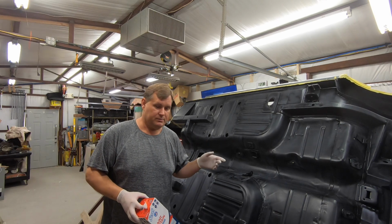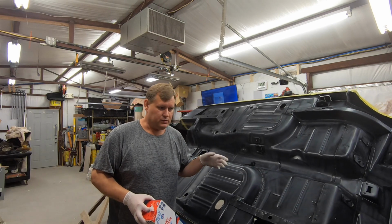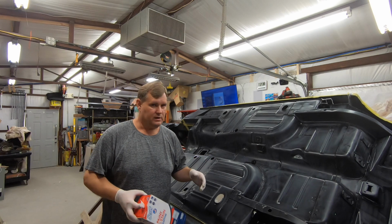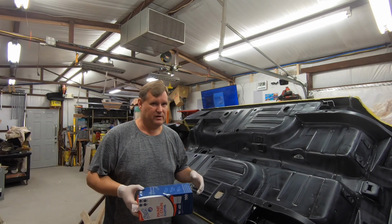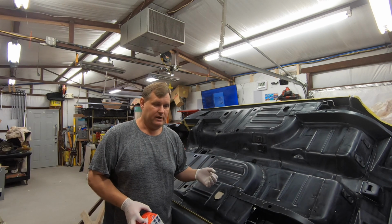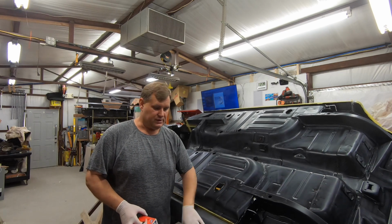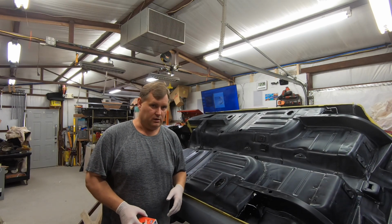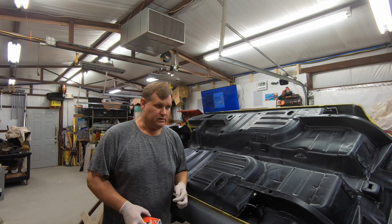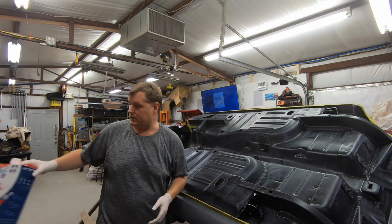So my next step is that I'm going to do this with wax and grease remover. Because the idea is that the blowing gets some of it off, and this gets the majority of it off. I'll do the wax and grease remover, and then I'll let it dry. And while I'm letting it dry, I'm going to start masking off with plastic so I don't get it all over the body, because I'm not going for the four-wheel drive off-road look on this Mustang. I don't plan for this one to be in its natural habitat in the ditch, so I'm not going to go that route.